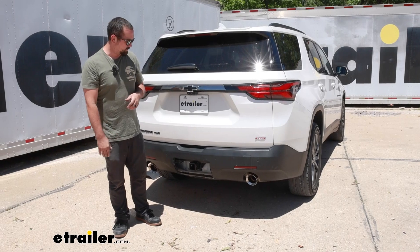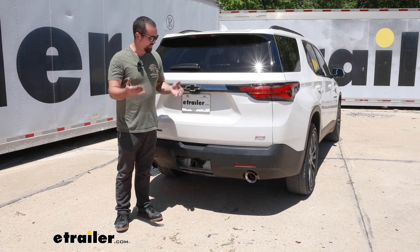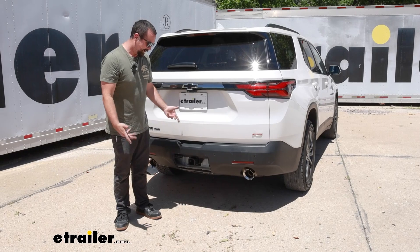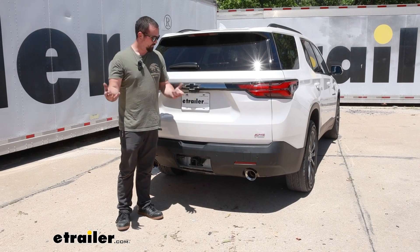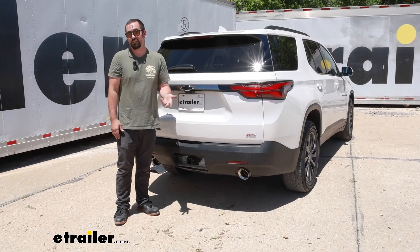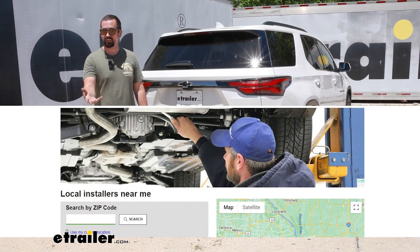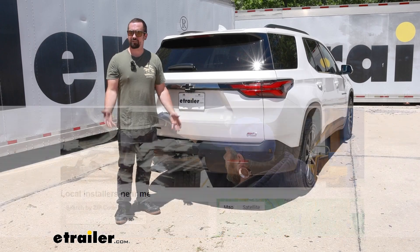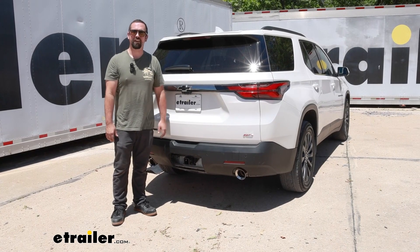From there you're really just bolting in some hardware — we're going to fish it up and you will have to drop the exhaust slightly, but that's part of the installation as it bolts into the bumper beam. Overall it's not too terribly hard to do in your driveway or garage. If you watch the video and decide it's not for you, you can use eTrailer's dealer locator to find someone close to you. For DIYers, follow along and I'll walk you through all the steps.